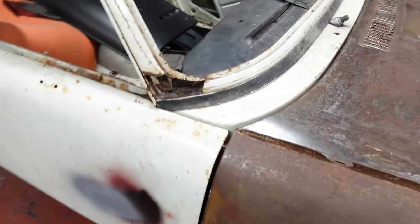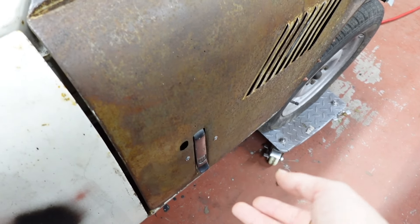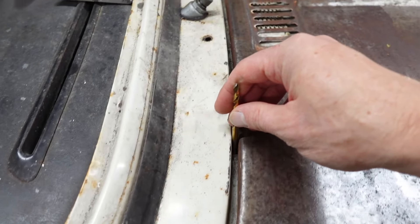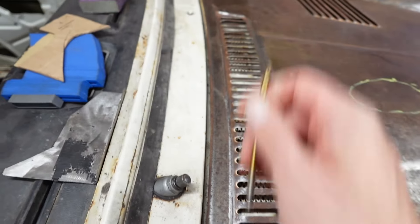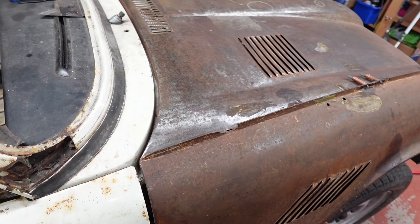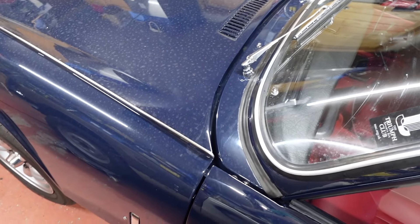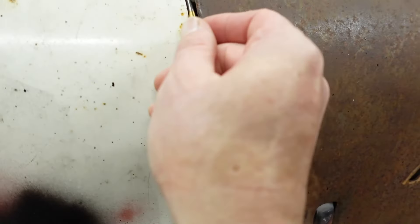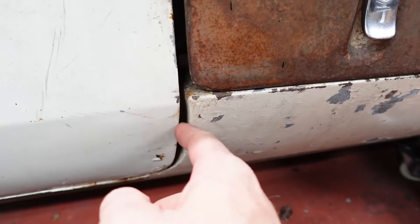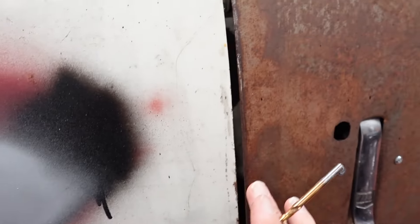After some more playing about, particularly with the bonnet cones, I've got this latch out and adjusted both of the catches that are attached to the bulkhead down a bit. I've got my 5mm thereabouts all the way across there. It's wide at both the rear edges — I guess this is just how this scuttle top and bonnet must be. My Spitfire is pretty terrible, but that's another story. This is mostly even — this is wide but quite even. The sill to door is a bit weird there.